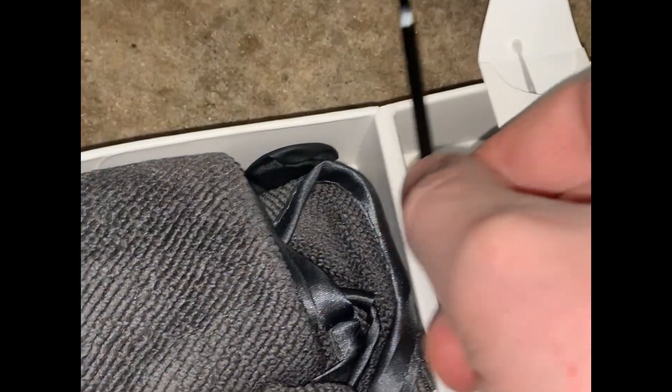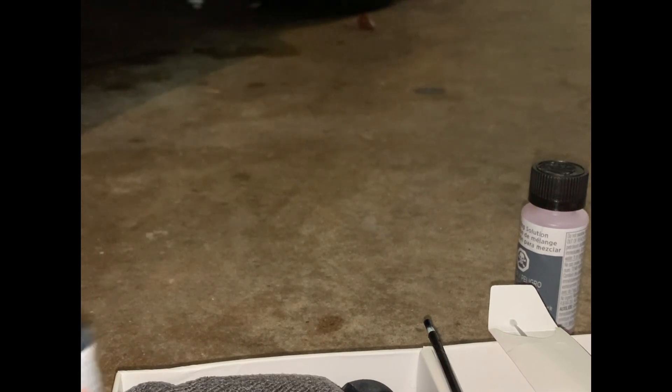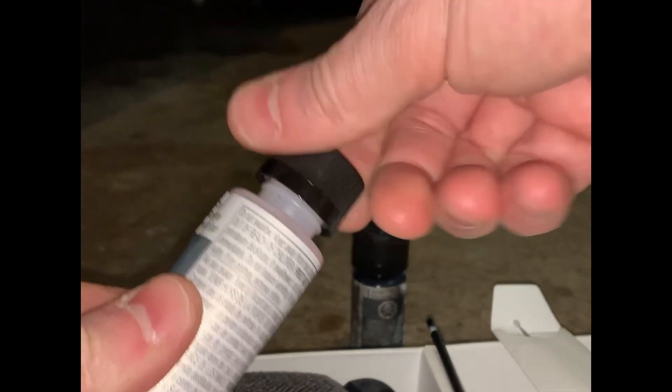So I'm applying even a little bit more paint because I can still see the divot very clearly — that's not what you want. So I'm applying yet another coat, and this is before I apply the blending solution. After I apply that second coat, as quickly and as lightly as possible, just slide it across — and now you can't see the mark. Do this once or twice; this is creating a base layer. Wait a couple of minutes — you don't need to wait the full five minutes the instructions say. I've had success with just two to three minutes.